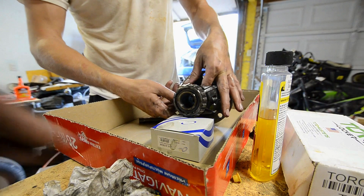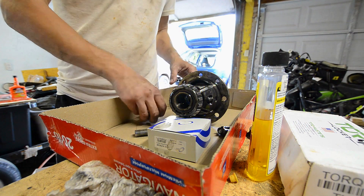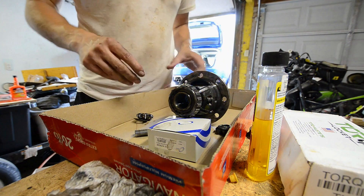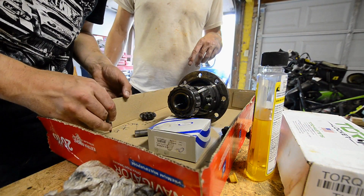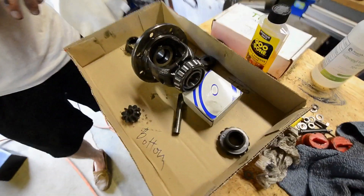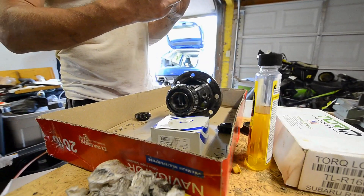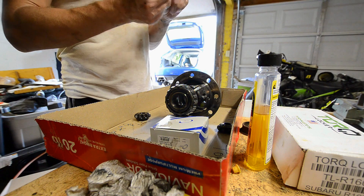Keeping track of these — top, bottom. The top is the side with the tension pin. You might want to mark it — we can mark the box and take a picture. There's the ring gear. We use a little system to not get anything mixed up. We do note some light polish marks on these, which the manual warns you about, but I feel like this is inevitable because the rest of the pin has some sort of coating and that coating is not going to stick around if you've got a gear riding on it. So I don't really feel like that's a problem.